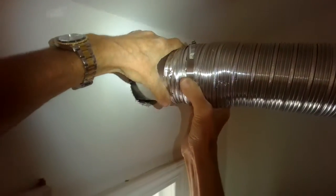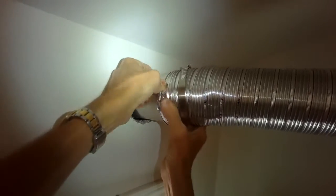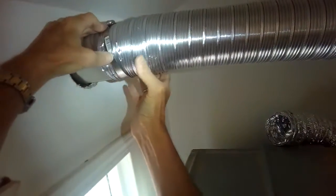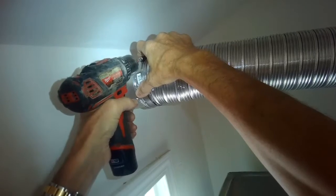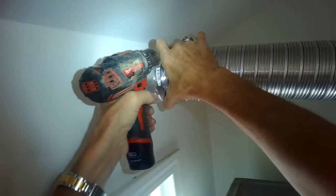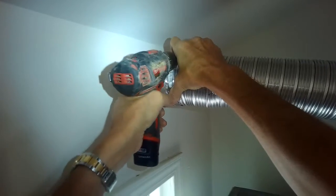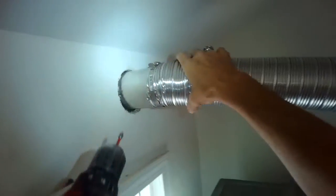This arrangement though, where the dryer vent heat and gases have to go up and out to leave the apartment, is not great because it makes the dryer lint collect down near the lower portion where it's connecting to the dryer. These are more likely to clog, so not ideal. If you have this arrangement, you have to clean it a little more often.